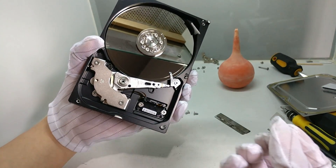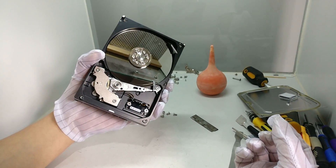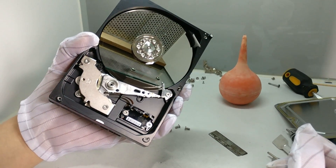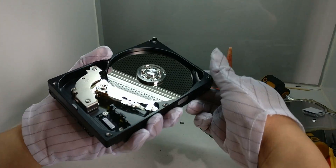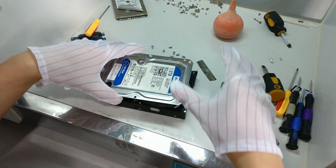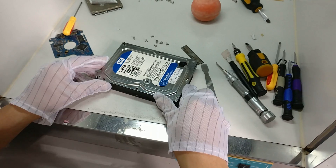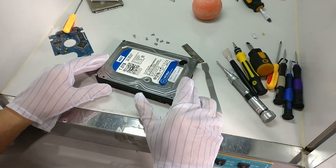We have installed this to bypass the scratched area. The top surface has scratches, however the bottom surface is okay. But if both surfaces have scratches, the chance of data recovery is very small. If only one surface has scratches, it is possible to recover the lost data — visually recover data from the bottom surface which has no scratches. After finishing recovery from the bottom surface, we install the lid and recover the remaining data from the scratch surface with the help of the head comb.